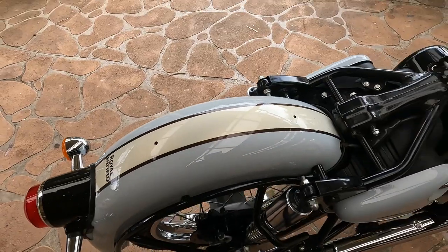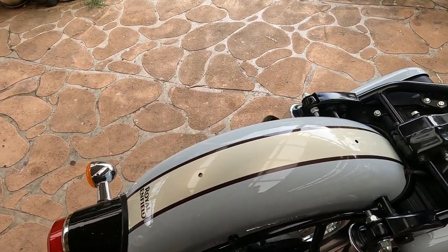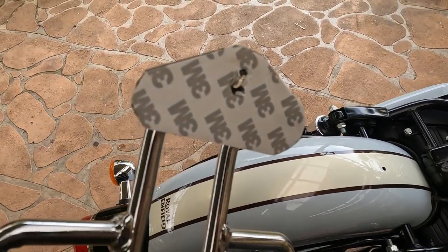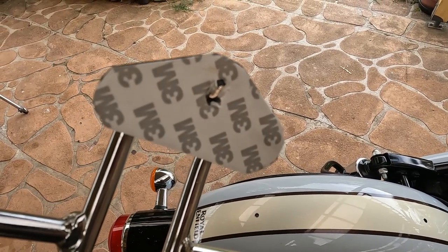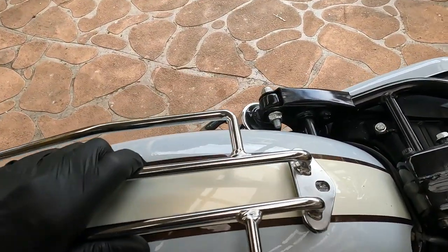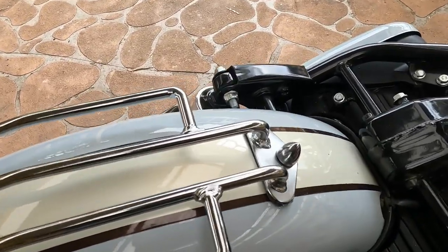What I'm going to show you now is here at the back of this plate. Normally if you just put this straight down metal to metal, you're going to have trouble with it rubbing later on — scratches everywhere. So what I do is use a pad of 3M double-sided tape. I've taped one side to the unit, and I'll leave the other side there for extra suction. I've done that to both ends so when I put it down it's not going to gouge marks through the paintwork. Nice and sturdy with the bullet bolts in it.